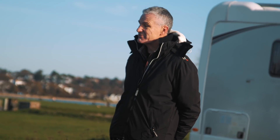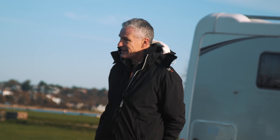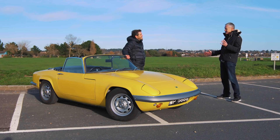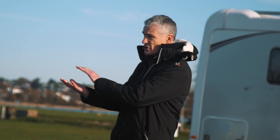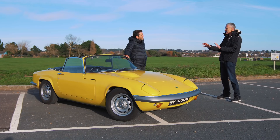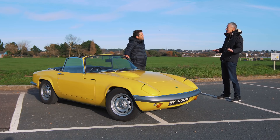Added lightness! The research into the batteries pointed to Tesla because their batteries were, at the time or still are, the lightest for the amount of power they give. So I used five Tesla modules out of a crashed Model X and put them in different positions — three in the front and two in the back — to get exactly the same weight distribution as the original car. Those five modules actually weigh the same as the twin cam engine: three in the front are 75 kilos, two in the back are 50 kilos, and the motor sits underneath and makes up the difference.